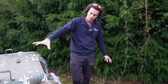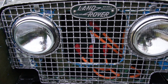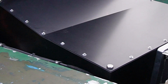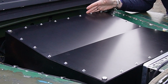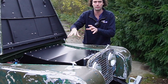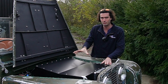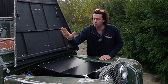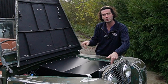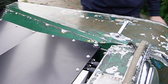Looking at the front grille, you'll notice the inverter is behind it - that's crucial because it's an air-cooled part. Usually we put water cooling through it, but we thought we'd try air cooling this time. Under the front is the five Tesla battery pack. Usually from our other videos you'll see a big casing over the top with the inverter, BMS, contactor circuit and everything in it. Because it's a Series 1 we're starting with a much smaller area, but we still wanted to get five batteries in it. So we've had to relocate some things to the back. We've got two batteries at the back, three at the front, a big disconnect, a couple of plugs to send wiring back to the inverter, and a data cable section. The front's actually pretty boring.